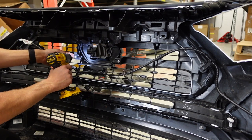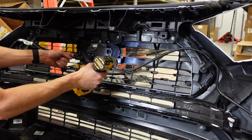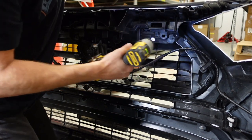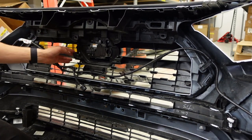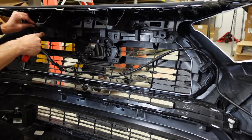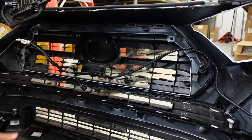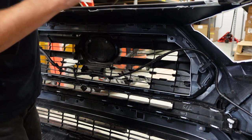One, two, three, four, five, six — that should be six small screws. Now removing the TSS sensor — it's connected via a couple of screws, but it will be free. You just have these two additional clips right here. We're going to yank those off and pull it down a little bit, push and pull it off. The TSS sensor we are going to take out as well — that's literally just these three screws, one, two, three.